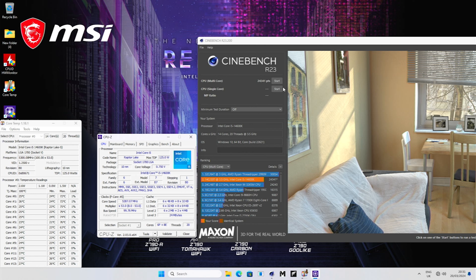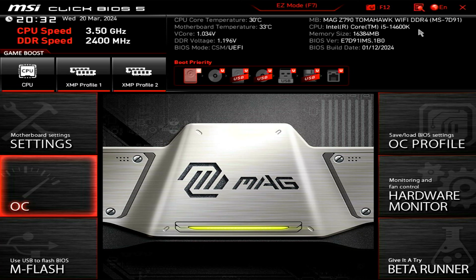That's a great start. What we're going to do now is actually go ahead and do some overclocking. For those of you who just want a cooler-running processor without overclocking, definitely download the latest BIOS and disable CEP support — that will make your processor run a heck of a lot cooler. Now we're going back into the BIOS to do some overclocking.